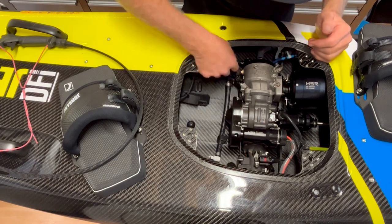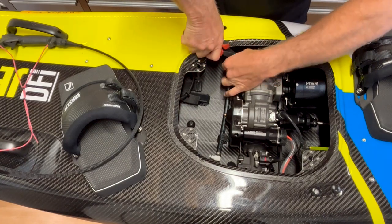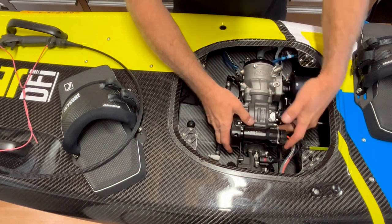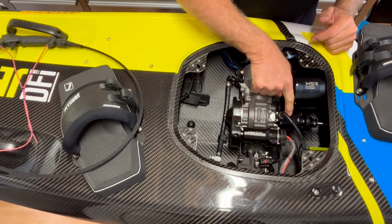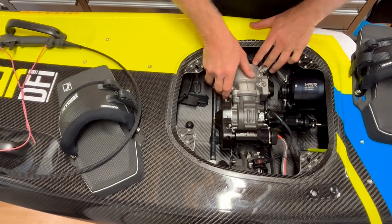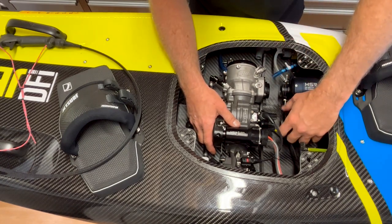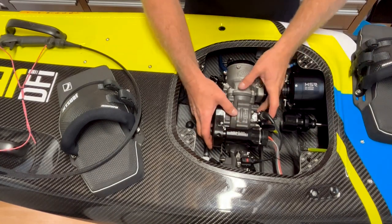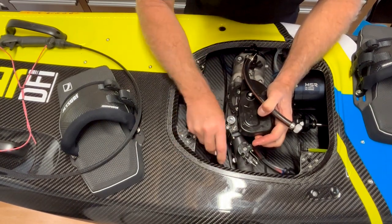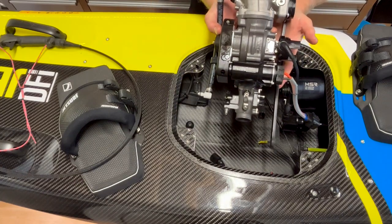One more cooling tube to snip off — make sure that cable tie doesn't end up in the engine bay. Now we've got the engine and exhaust and the coupling that need to come undone. That's just O-rings on the exhaust side — just give it a wriggle. The coupling just pops out; it's a three-legged coupling arrangement with some little white cush drives in there. Be careful that all stays in place. Now tip the engine outside and just slowly slide the throttle cable over, and then the engine will very carefully come out of the engine compartment. There it is — job's done.